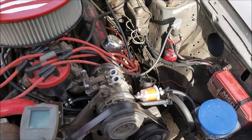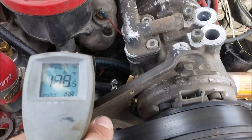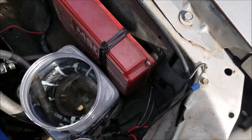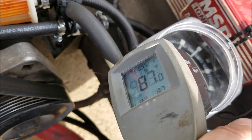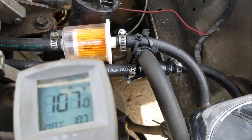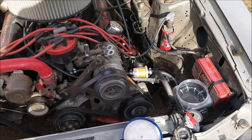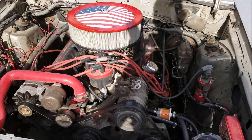I've got the IR gun here. We'll take a look at the fuel line coming off the fuel pump that was previously getting really hot. Coming right off the metal line — the car has been sitting a bit — it's reading about 150°F and cooling down. Shooting the side of the fuel line inside the fix, we're coming in at about 87°F. Then checking the fuel line coming out after heat soaking for a while, it's only about 105°F. So you're dropping your fuel temperature a good 30 to 50 degrees, and that makes a big difference in how dense your fuel is and how much fuel gets into the cylinder every piston stroke.